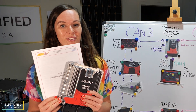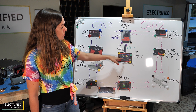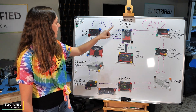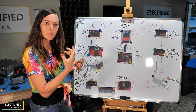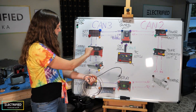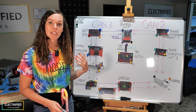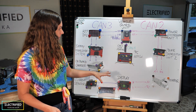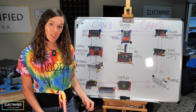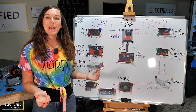The VCU 300 has three CAN communication lines. CAN line 1 makes the connection from the VCU to the computer and the AEM calibration software via a CAN to USB adapter. Then there are CAN 2 and CAN 3 that control all the electrical components. Both consist of CAN high and CAN low, and we'll cut this and make connections to individual devices wherever they are in the car. Some components have internal physical terminations, others do not. It takes some time to figure out where everything goes, and the order depends on where devices are in the vehicle. Overall, you want to minimize branch lengths.